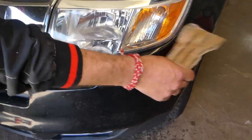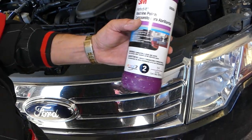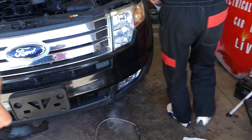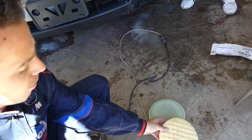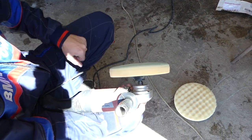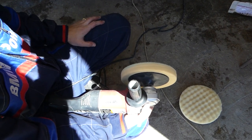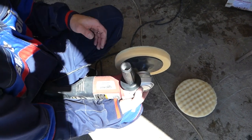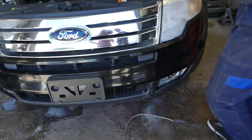For the next step, we're going to remove the cardboard and apply Step Two machine polish. I'm going to change the pad from the rubbing compound pad to the polishing pad. Again I'm going to go at about 1800 RPMs for this step as well. The polishing pad is soft on every side so you still have to be careful, but you won't easily damage the bumper.